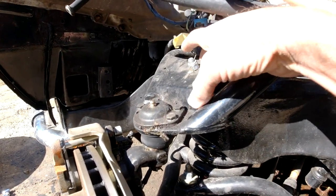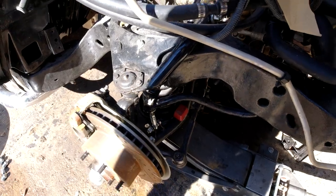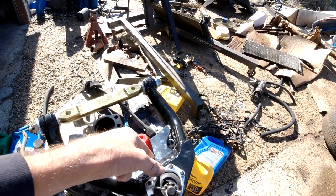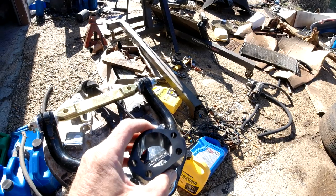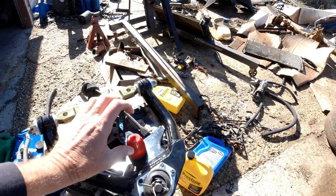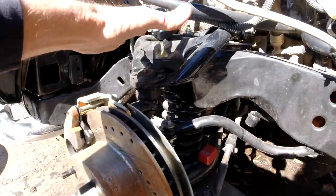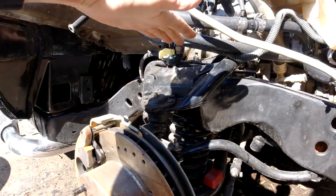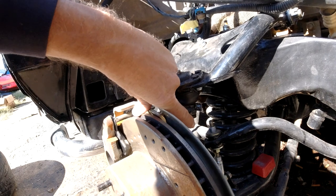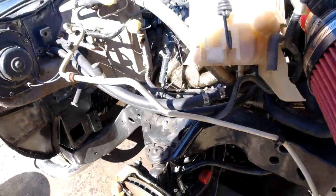On the other side the little rubber stopper is crushed. I measured from here to the bottom of the ball joint - with this spacer it'll be a half inch taller than factory, so it should work. We should see quite a bit of difference before it hits the frame so it can travel. Right now there's no travel because it's sitting on the frame. Let me take this cotter pin and bolt off and we'll go from there.